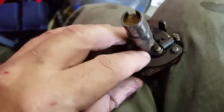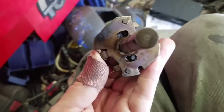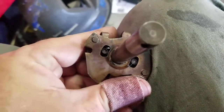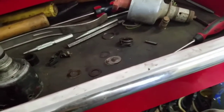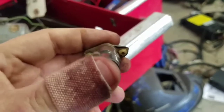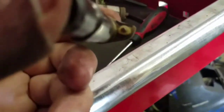If you hold it open and turn it, it bottoms out — so you'd think you'd have to grind that out. But notice that fully closed, there's plenty of room to go backwards, and that's actually the trick. With HEI distributors I used to add more retard — start off tighter — and that's exactly what I'm going to do here.